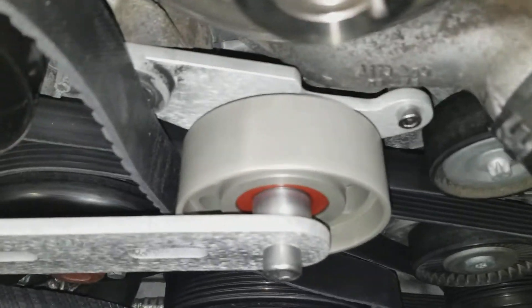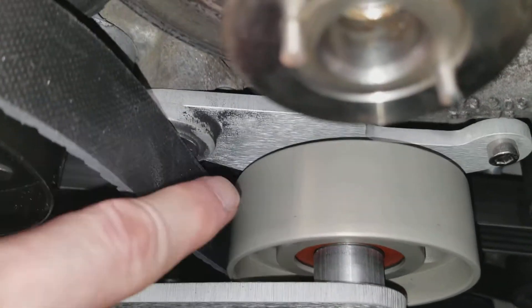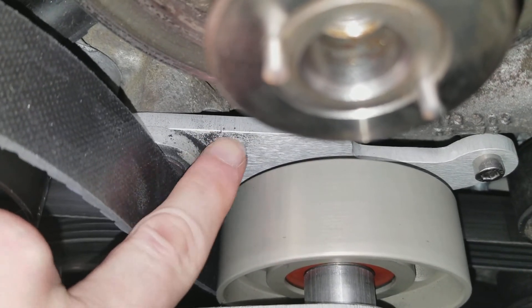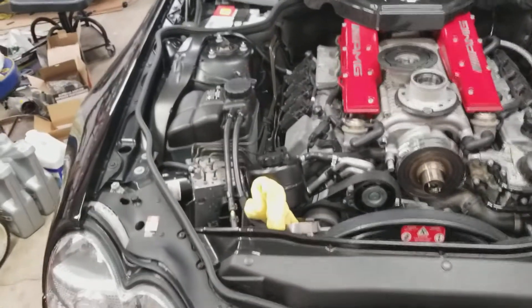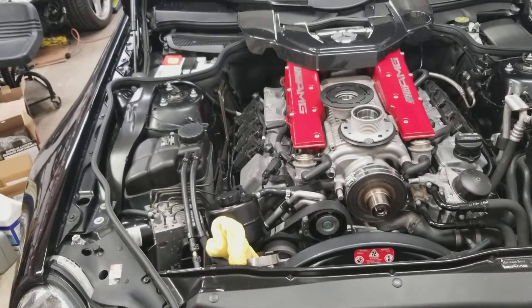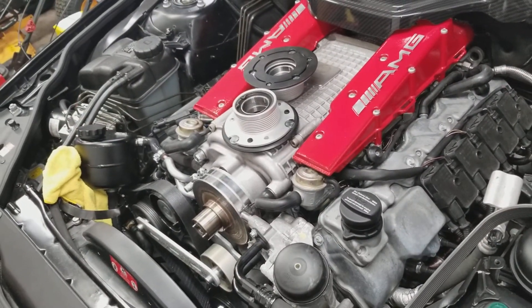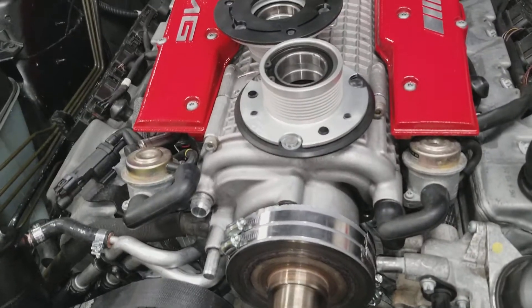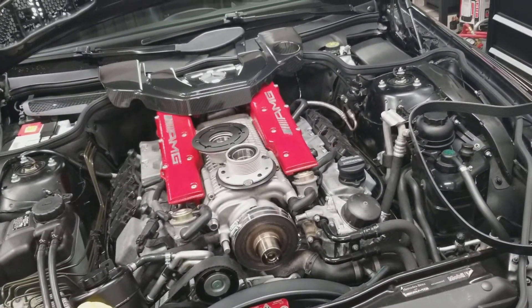This dust right here is actually from belt slipping — that's when it wears away and when the belt slips, that's when you lose power. You supposedly lose 10 to 20 horsepower for every psi, so losing 2 to 3 psi means basically throwing away 20 to 40 horsepower that you've already paid for. Hopefully this machining process helps recover those horsepower gains. I'll post up some results probably midweek.